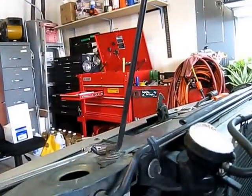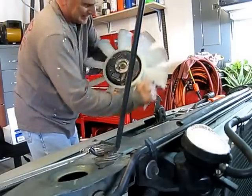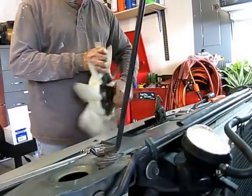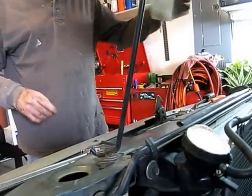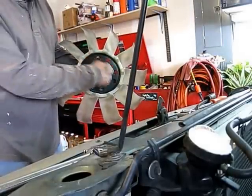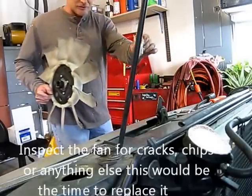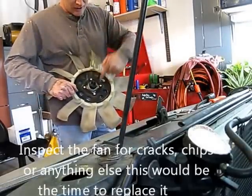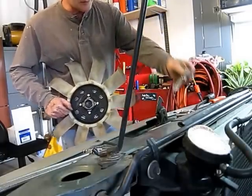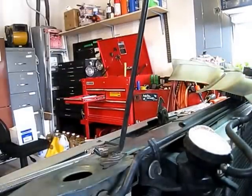The fan was really easy to turn on the new one. This old one is not turning — it's a bad clutch. It runs all the time; not horribly bad, it just kills your fuel mileage. Eventually it will lock up and it won't be any good. On the back of this particular one we have four screws — we're going to take those off. The kit comes with four new screws. Please use the new screws. I'm going to begin putting it back together.